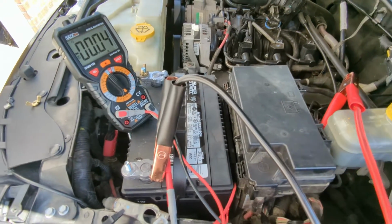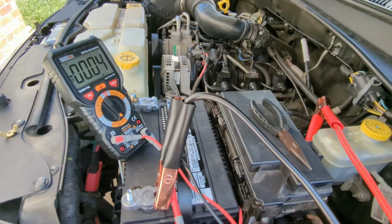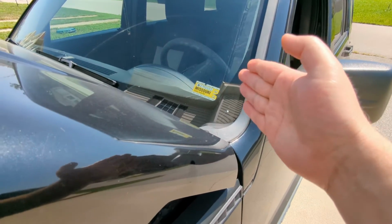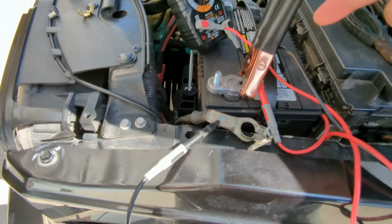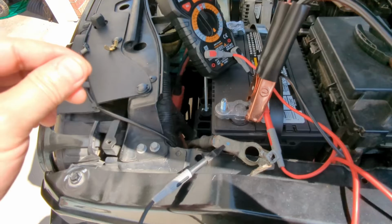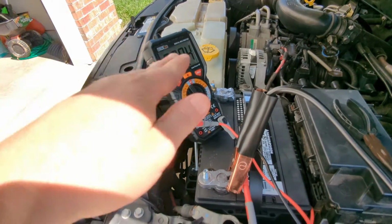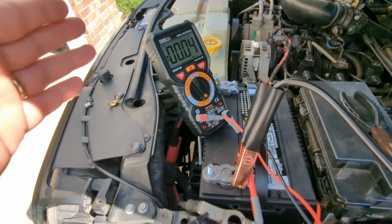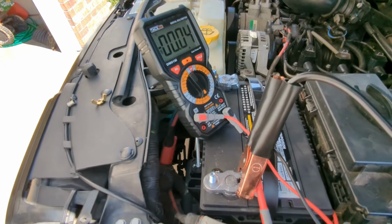The main thing is you need to troubleshoot these exactly the way you leave them. So you need to shut the car off, remove the key, come over here, and hook it up the way I did, where it's going to be in series. Once you disconnect it on the negative, disconnect it with the meter in series, and then watch that meter until you see a large current fall off of it. Then maybe I'd give it 10, I'd even maybe wait 15 minutes.